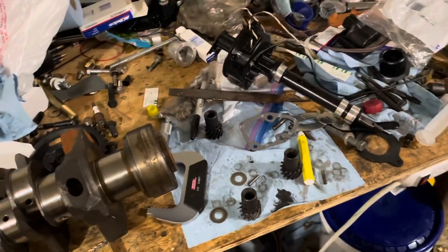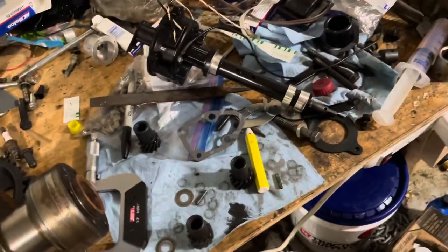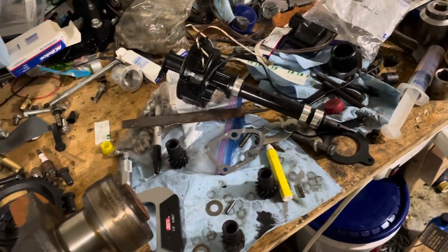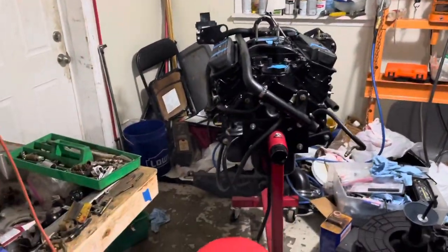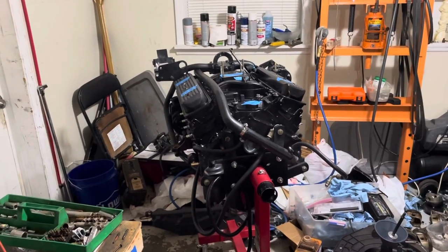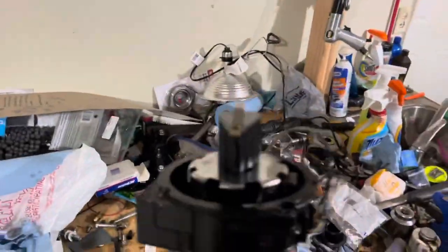Back to what I was saying about the gear being right — if you put this gear on 180 degrees out, you're off by half a tooth. Well, it doesn't really matter in these type engines because to set the timing, you rotate the distributor. So all you're going to do is compensate for the gear being off half a tooth by just rotating the distributor to another location. The distributor is internally — it's called distributor phasing. Let me show you what that means.